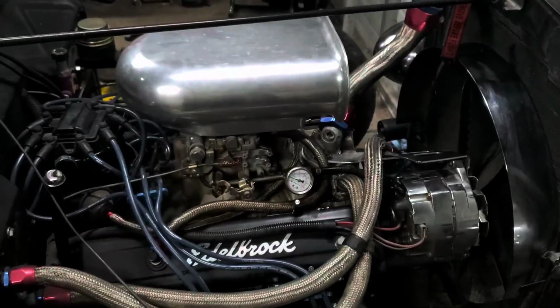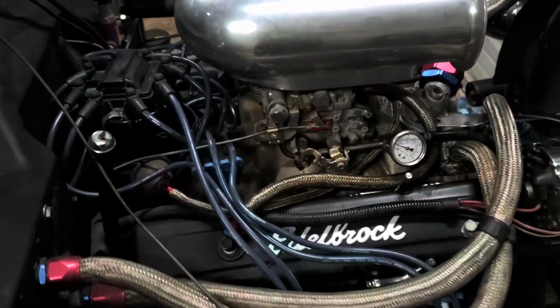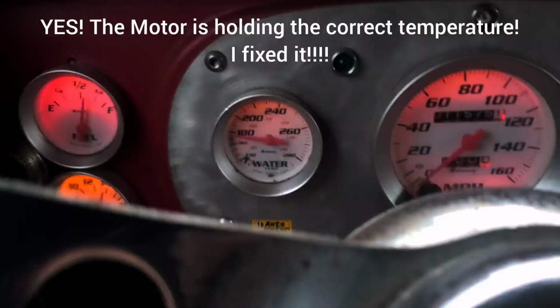All right, that should be it on this motor. Got everything tightened down, put back in place. Got my valve covers all snug back down. All right, got those jobs all done. Now I have to add some more antifreeze and in the morning, I'll go ahead and do a test drive on it. Probably have you come with me and check that out. It's too late now to fire this thing up. I'll wake up the whole neighborhood and they won't appreciate it. But we need to get it up to temperature, see if it spikes or if the thermostat's opening a lot better than the last one did, or if it's the water pump. I'm pretty sure it's not the water pump, but if it is, then we'll get into that in another video.